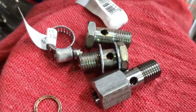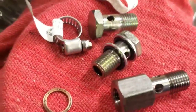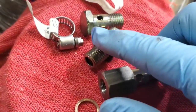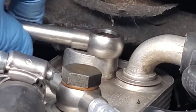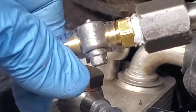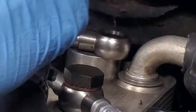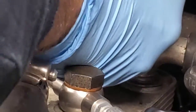While I was at the diesel shop I went ahead and got a few brand new seals and some regular copper washers, which I'm going to use just for the bleeding procedure so I don't ruin the ones that are on there permanently. Once you have your fitting off, make sure the area is clean before you remove it. Then take your new fitting, make sure the seals are around it, put the other washer on underneath, and start screwing it down.